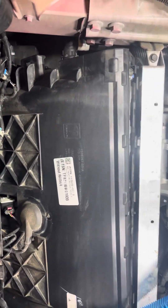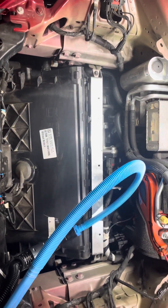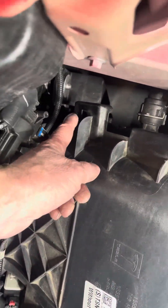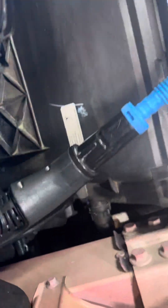One of the things I wanted to do was get in and clean the radiator off. Just like with the Model X — I have another video on that — you remove the tub, and then in the Model 3 there are clips on the side. You squeeze them together and then it will come up. Same thing on this side: squeeze them together and it will come off.